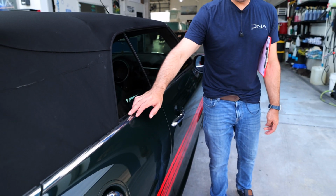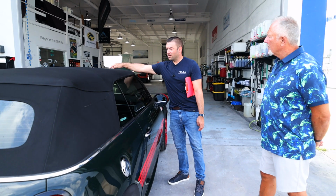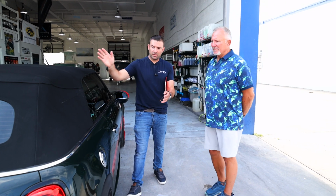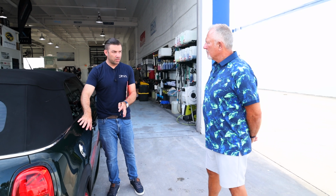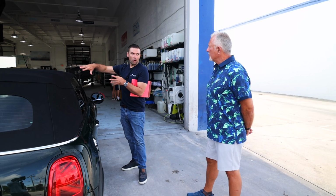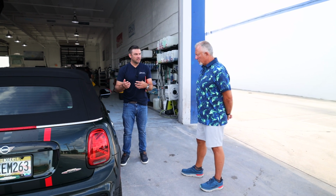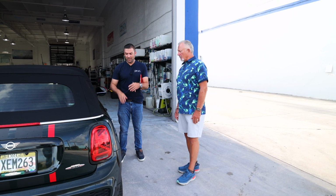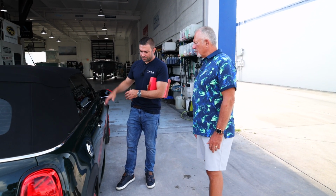So we're gonna take care of all this, and anything, kind of when we open this top up, this is all game in here. Oh, okay, yeah, wow. You got a seal in here. So, you know, believe it or not, when the boot comes up over this, you've got pieces in there. So whether we're using the hard coatings or we're using the Regenix, the water-based product, we're basically trying to touch all the weather stripping and seals that are in there, and even any of the mechanical workings. That's kind of the nice part about the water-based. We can just spray it anywhere, let it dry. You don't have to worry about it curing onto the paint. So everything's done. So we got that buttoned up.